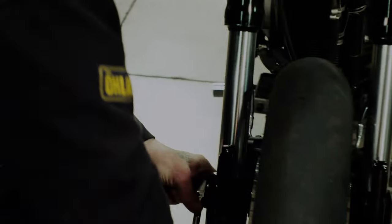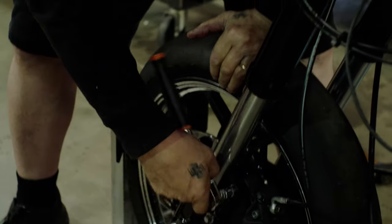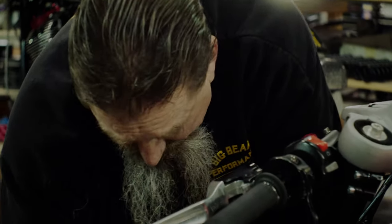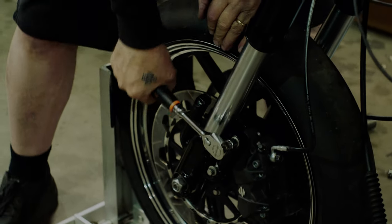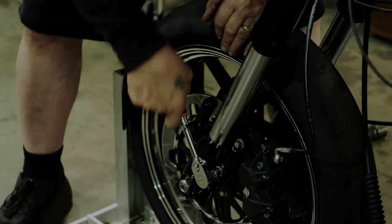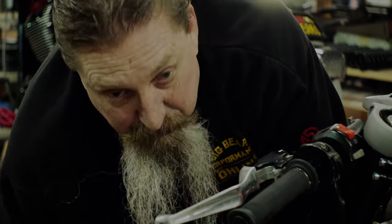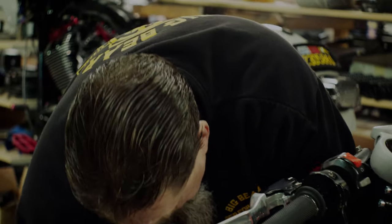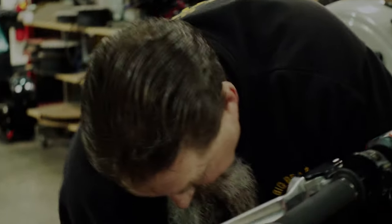Tomorrow's qualifying and then Saturday's the race. I think I just wanted to be there tomorrow, get it dialed in to where he's like oh my God, it's fucking amazing — and then let him race. I'm going to put on brand new tires so we can see the tire wear. He's going to run an SC1, which is a super soft compound because it's so cold right now — it was pretty crazy how cold it was for the desert.